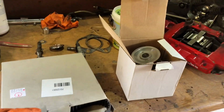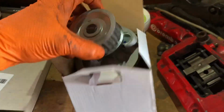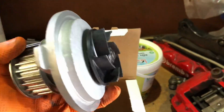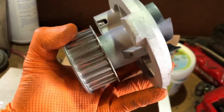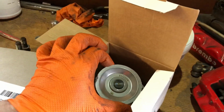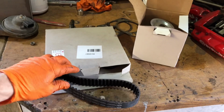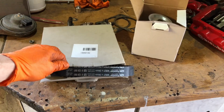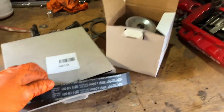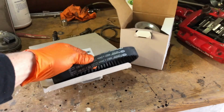So as I said in the past video, even though the cam belt and water pump wasn't in warranty still, Kurt Nevlock still sorted us out with a brand new GM one, even though it wasn't his fault. But it's been leaking from the usual place that they leak from when they've done 100,000 miles, but this one's only done a couple of thousand. It started leaking pretty much straight away. So we've got a GM one there, GM Gates belt as well to fit. Don't need any of the tensioners or anything because they were changed very, very recently, so we're just going to swap that over. Obviously I didn't want to change the water pump and not change the cam belt because, you know, you can pick up little bits of damage. I don't like using second-hand cam belts for the cheapness of them.